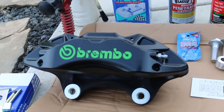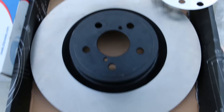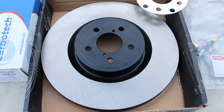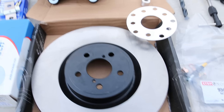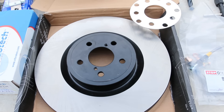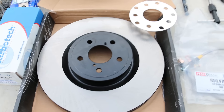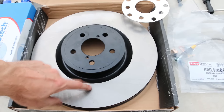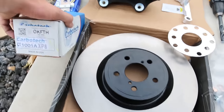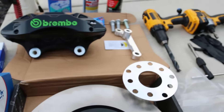The white stickers I ordered were super small and my buddy Kevin gave me these green ones — they look cool but I may go with white soon. These are the 2004 STI rotors. These are what you need because they are 5x100. If you have a 2015 you'll have 5x114.3 and you can use regular STI rotors. You can go drilled or slotted if you want.